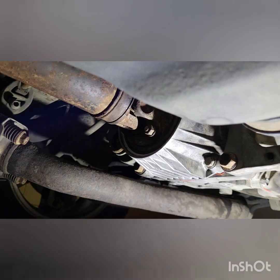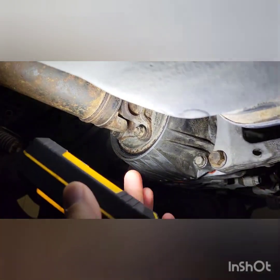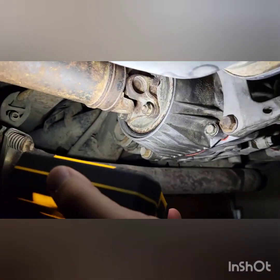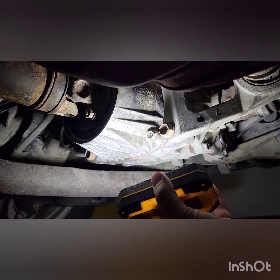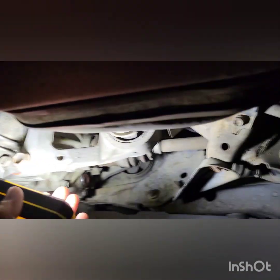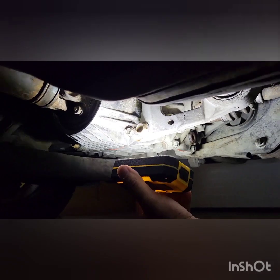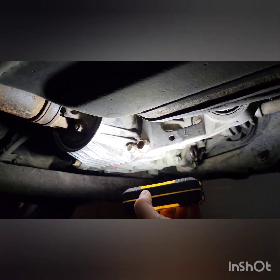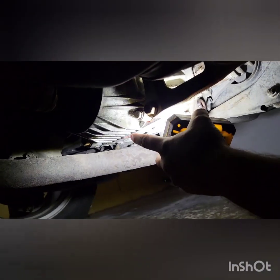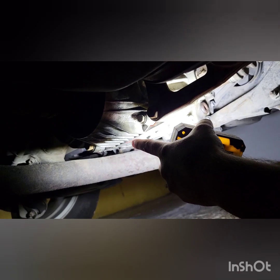The pinion gear is up there on top. The pinion seal goes around that transmission shaft — that shaft from the transmission spins, and inside there are all the gears and cogs that transmit the rotational force horizontally to the tires. It's a differential, so each tire can spin at a different rate when going over terrain.